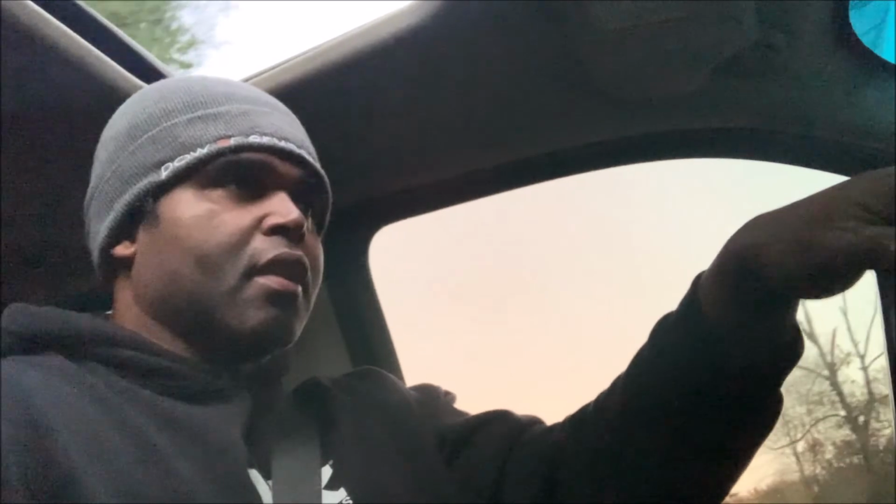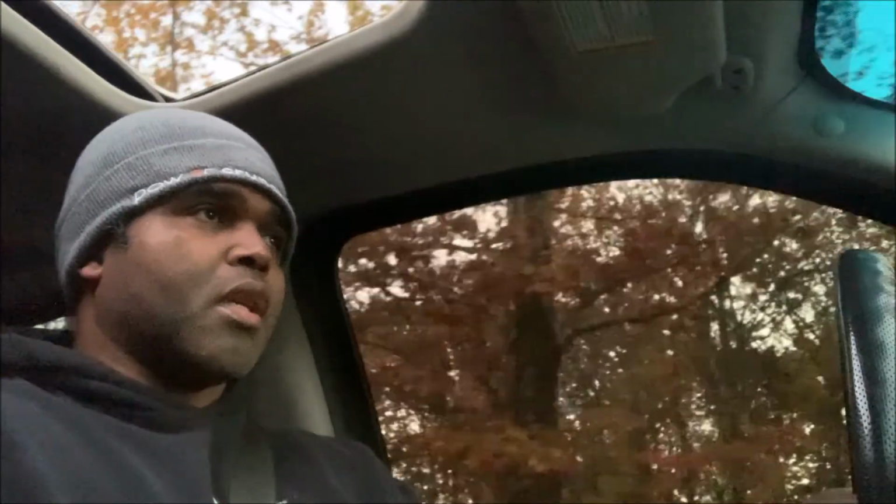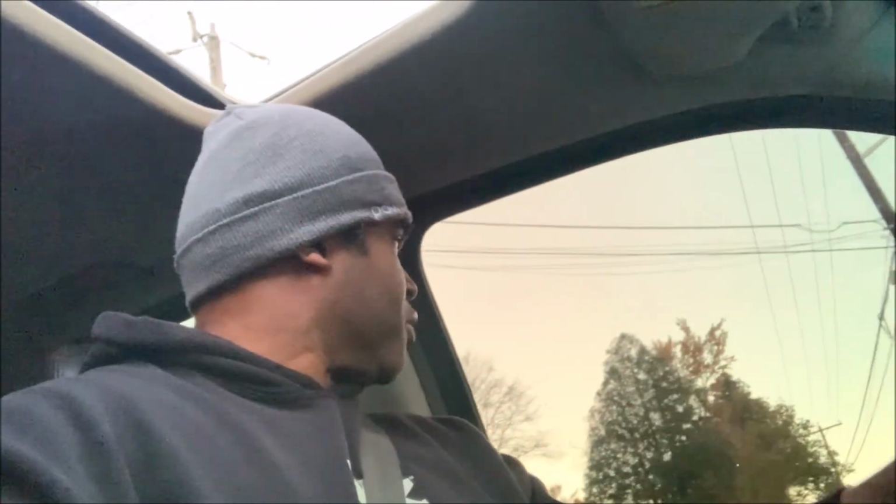All right, let's go. All right, 40 miles an hour and down to 10. Down. 10 miles an hour, okay. So that's about number 5. So now we're going to go to 30 miles an hour. Break it down to 5 miles an hour. Pick that up. Do that 5 more times. 4 more times. I'm trying not to step on the brakes when I come to a stop. Just cruise to it. So we don't get an imprint, which can cause judder, J-U-D-D-E-R.